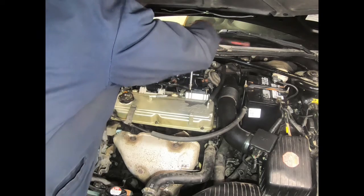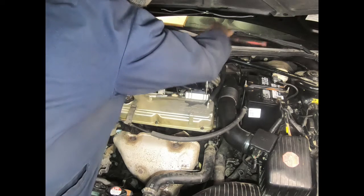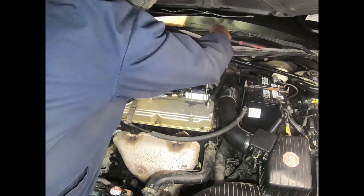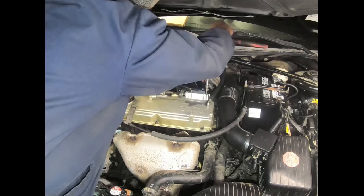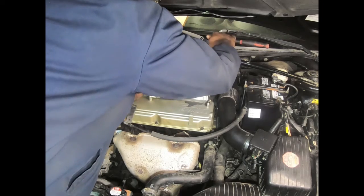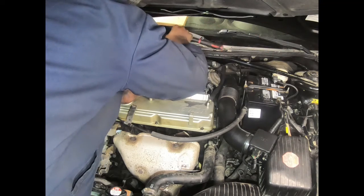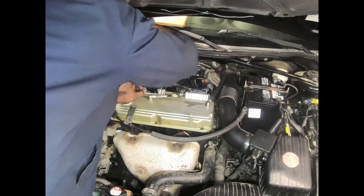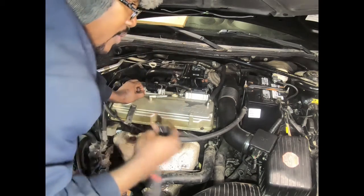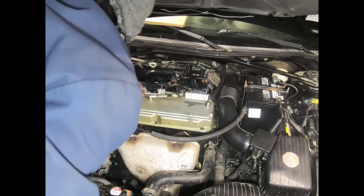I think Rich was talking about, I hear it missing. Maybe something's wrong with the coils. So I got brand new spark plugs. I can buy the coil packs, it's only 2 coil packs, $26 on Amazon. The wires, $12 off Amazon. There's only 2 wires. It's no biggie for me. Get them changed.